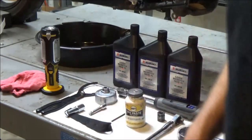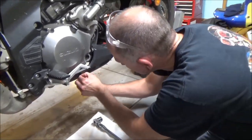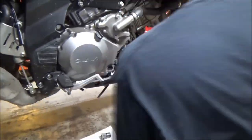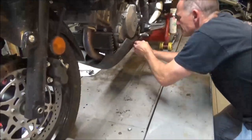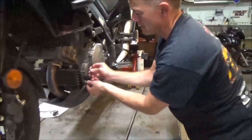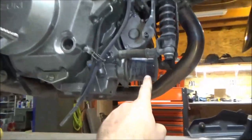Let's go ahead and start the process of the actual oil change. Steve's removing that little cowl right now with an allen key wrench — it's a four-millimeter allen, four bolts. Slip it off, organize it, set it to the side. Now that we're at this point, we can start to see here — our goal is to get the oil filter off.